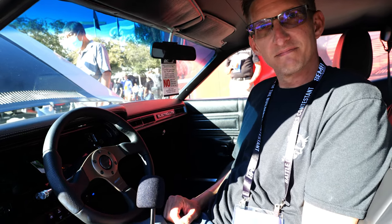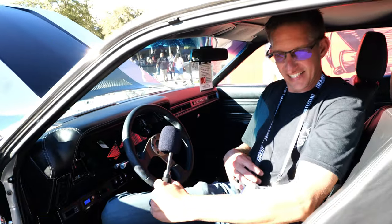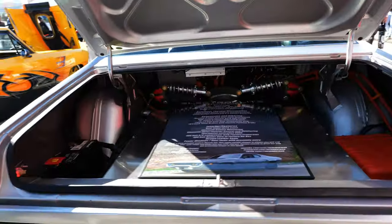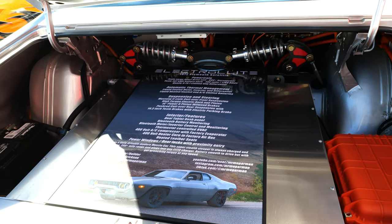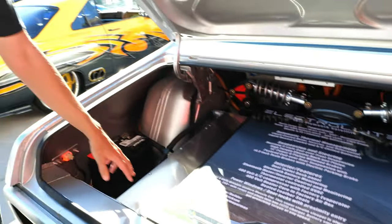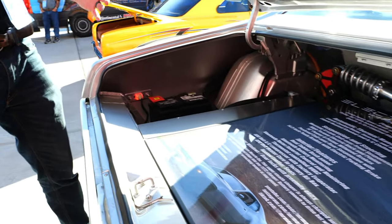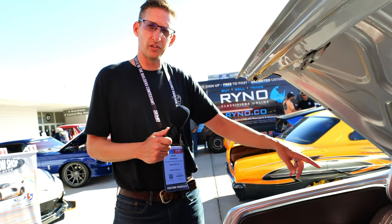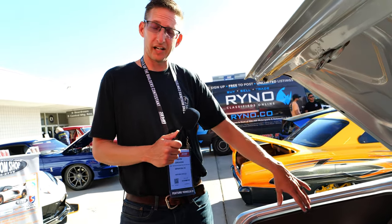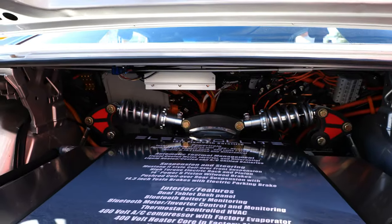In the trunk: with the 100-kilowatt-hour battery pack repackaged, 10 modules are under the hood and six more are in this box. You have to equally cool all of the batteries, so each box has a built-in cooling manifold. All three manifolds run in parallel flow — all 32 cooling loops are equally flowing throughout the battery.